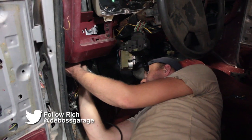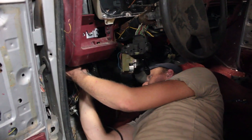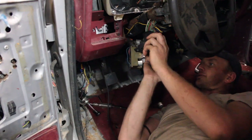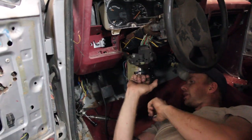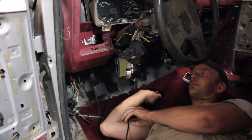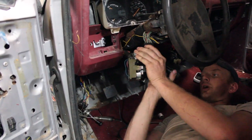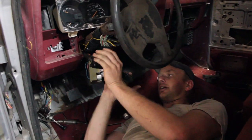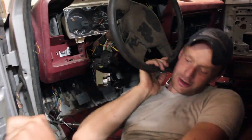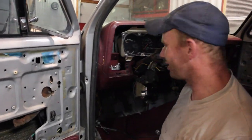It's not going great. I got the flashes working and a bunch of other stuff working, but we don't have tail lights — we do have headlights though, and we're thinking it's in the turn signal switch. It's a pain already because the wiper isn't working properly, and out of our three trucks we only have one that works so-so. The wiper still comes on but has a hard time going off. This wiring is as frustrating as can be.